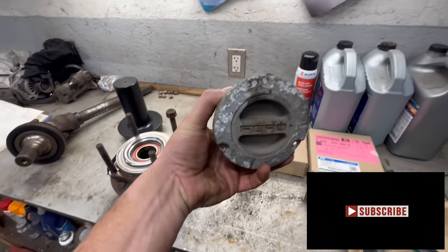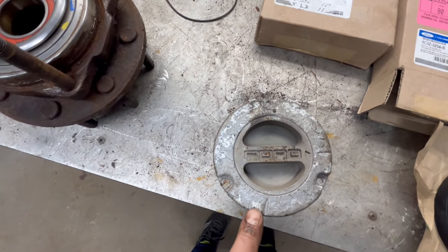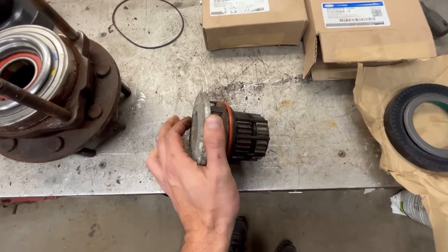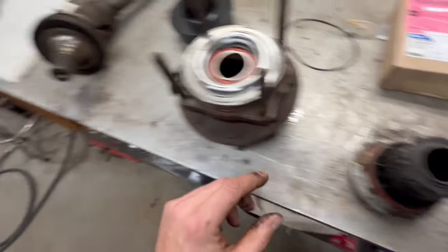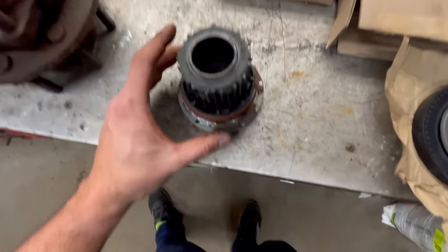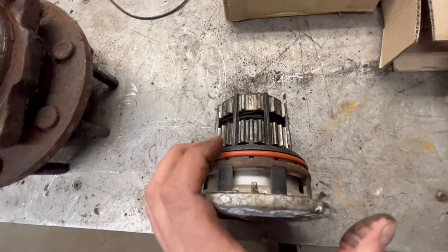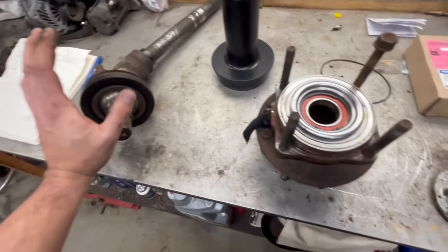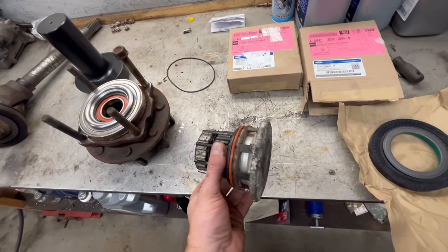Getting back to a little thing with the locker - as you can see right here, the hub is in auto right now and this is lock. It's a little bit hard to turn right now. As you can see these gears right here - this is auto right now. It spins. The end of the shaft here, the spline, goes in here which makes your four-wheel drive work. Right now it's in auto. If I spin this to lock, it actually pushes in here and forces it to lock. But right now, the only way this can activate in auto is vacuum, which is provided by your seal, the vacuum pump in the truck, the lines and whatever else. That's what makes this auto four-wheel drive work, which is pretty cool.